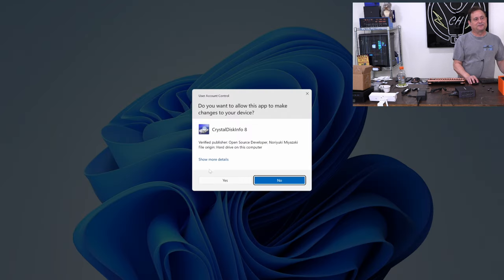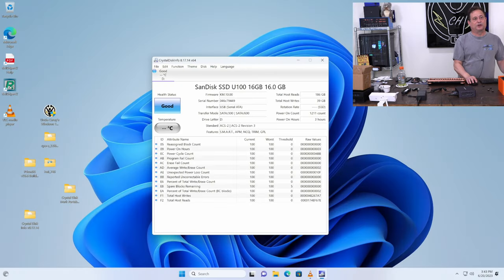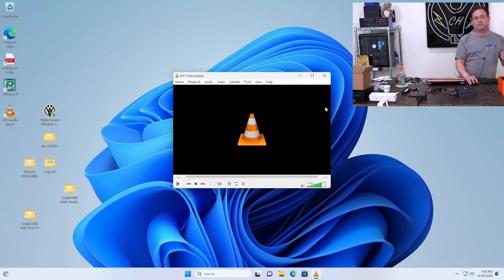Watch this. We've essentially created our own hard drive. So all it sees is the flash drive. It does not even see our C drive at all. So be aware, any sort of drive-specific utilities will not function while you're in RAID mode. So that is sort of a consequence that you're paying for in exchange for the performance.